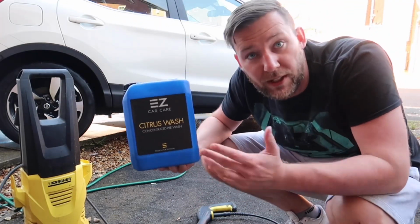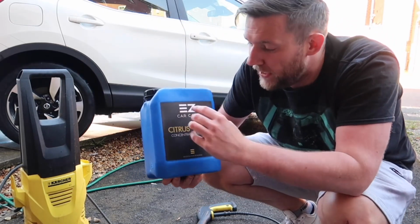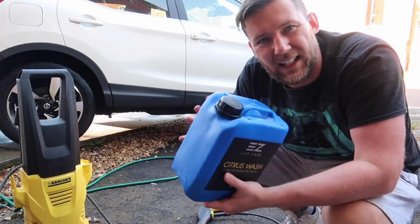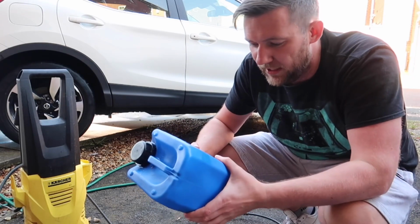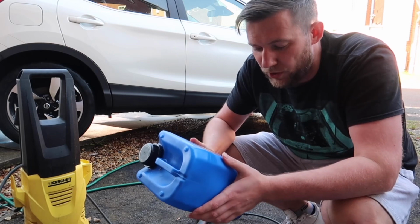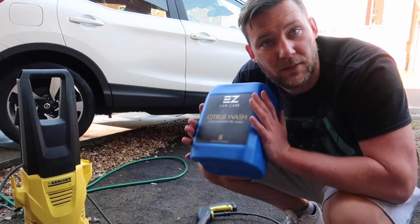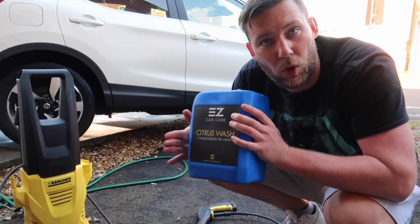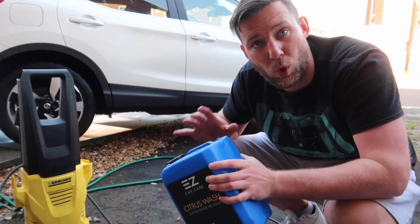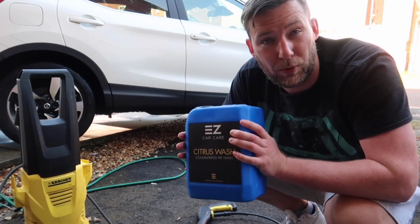I've used it in a previous video. I reviewed this product on the channel. If you've not seen it, go and check it out. It's EZ Car Care Citrus Pre-Wash. Now in that video that I mentioned, I did get it a little bit wrong. I read the back of this, and it says that for extremely dirty vehicles you need to do it at a 10:1 ratio. Now I took that as 10 being the product and the 1 being the water, but it's not, it's the other way around. So I want 10 parts water, 1 part of this product on this car for the pre-wash. That's what we're going to do next.